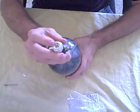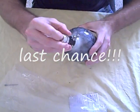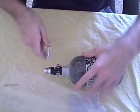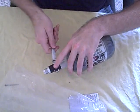Now, obviously before you take apart your fill nipple, double check your gauge, make sure it's at zero PSI, push the pin, make sure there's no air in your tank. And take your 7/16th wrench and start removing your fill nipple.